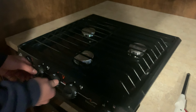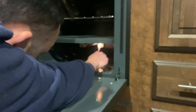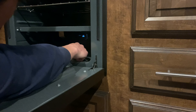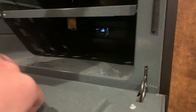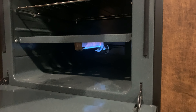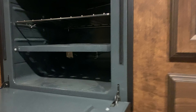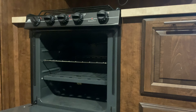To get the oven to light, you're just opening that up. You can take any lighter of your choice, turn that over to pilot, push and hold it, and run your lighter over the pilot — it fires right on up. Just push it in for another few seconds to allow it time, then you can turn it up to your desired temperature. Just be patient because sometimes it can take a while to purge those lines if it doesn't light right away.